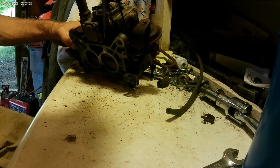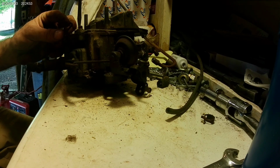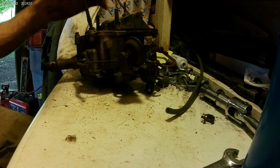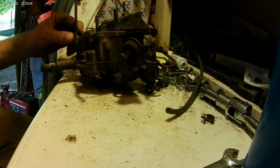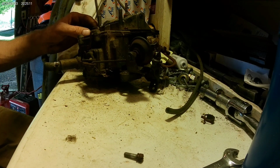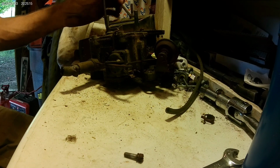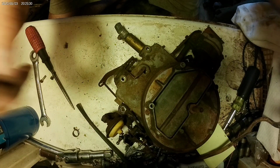Go with the usual Holley setting. Half, one, and two, two and a quarter. So let's go with half and half. Let's go with the Holley setting, which calls for one and a half turns, I believe. Or maybe it's no more than one and a half turns, but typically just to get it started, adjustment, you just go with one and a half. See what I'm doing? Kind of sort of, not really. How will this work? Yeah, that's better.